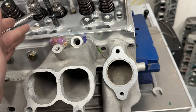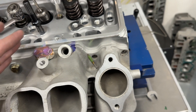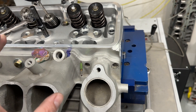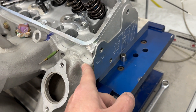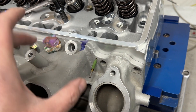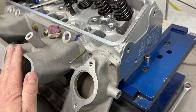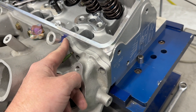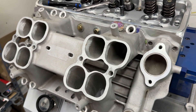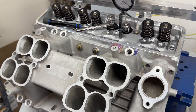With these AFR heads I had to use a thicker gasket on the intake side. Instead of using a 1206 — which is what this manifold kind of requires, that's a Fel-Pro number — I used a 1266, which is 120 thousandths, so it's twice as thick. The reason why: using a thicker intake gasket raises the port up, which is what we want, because there wasn't enough material to put the 1206 on top. These old manifolds were made for small port openings like a 1205 — they never envisioned ports being as tall as they are now. So the thicker gasket raised it up and gave me more material to seal. Then I port matched it and flowed it again — really cool.